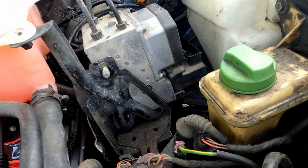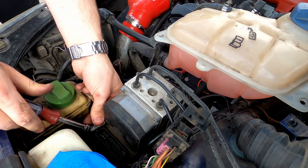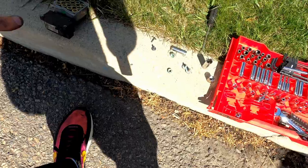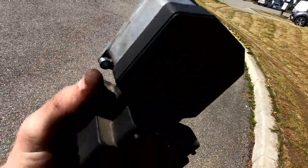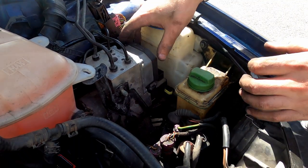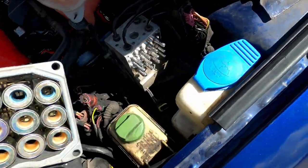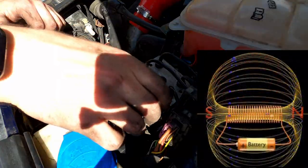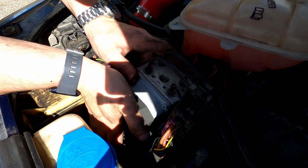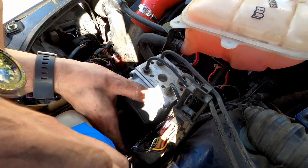While removing this, let's talk about how ABS actually works. Generally speaking, each one of your wheels has a wheel speed sensor that tells your car's computer how fast the wheels are turning. When you step on the brakes, it pumps brake fluid through the master cylinder and the ABS motor to the wheels. The ABS computer has access to the wheel speed sensors and can tell if the car is slipping due to a change in wheel speed. The round tubes in the ABS computer are solenoids — a wire wrapped in a coil inside a plastic housing — slid onto valves in the ABS motor connected to each specific brake line. If the computer detects a slip in a wheel, it sends current through that specific solenoid, creating a directed magnetic field that opens or shuts the valve to that brake line, adjusting brake pressure to regain traction. That's also why ABS feels like it's thumping on your feet.